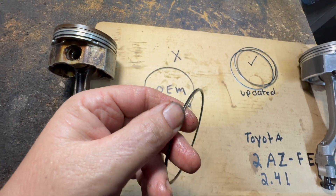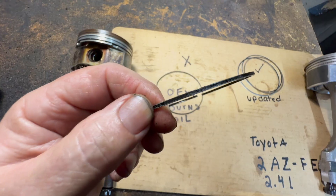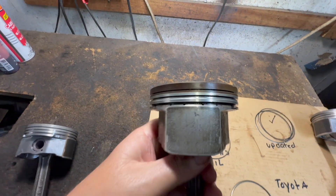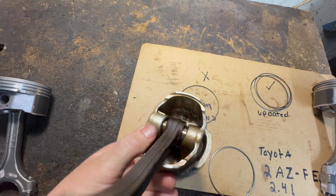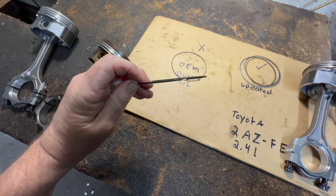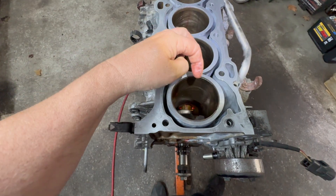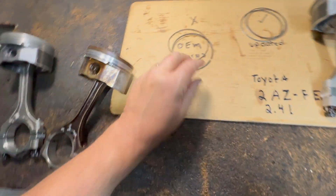The oil can drip all the way around the new design, but not the old one. What happens when you don't change your oil — carbon builds up. Natural carbon builds up anyway, but when you don't change your oil it's worse. It builds up so much that there is no way for the oil to go back in the piston. You can see some of these holes are clogged up, some are not. Now this ring is basically useless because it's going up and down in the cylinder.